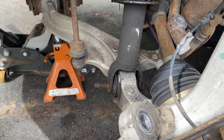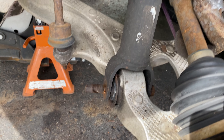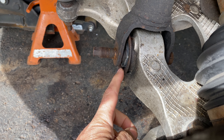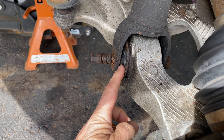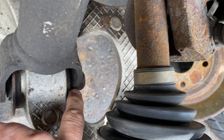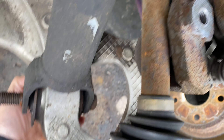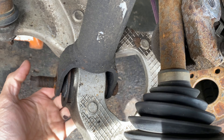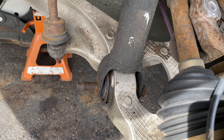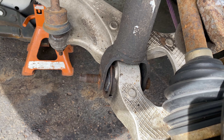Options would be to cut here and on that side to get the spring out of the way and give me a bit more room. Or I could run an angle grinder in this gap, chopping through the bolt on that side as well, except it's going to be a wee bit difficult because I don't have a huge amount of space. The angle grinder would need to come in from the underside. Then I can get the spring assembly out of the way and hopefully use my ball joint removal tool.